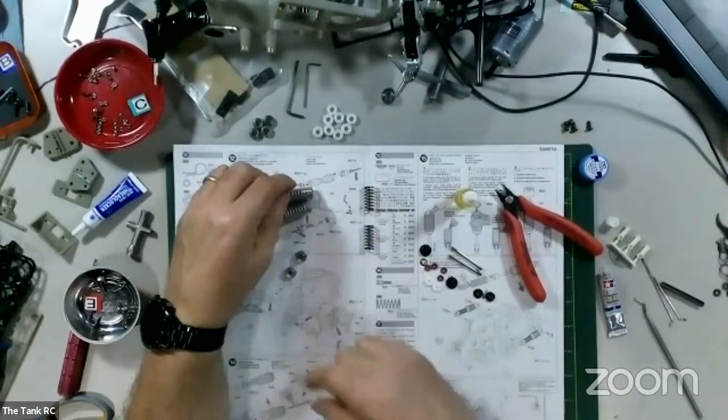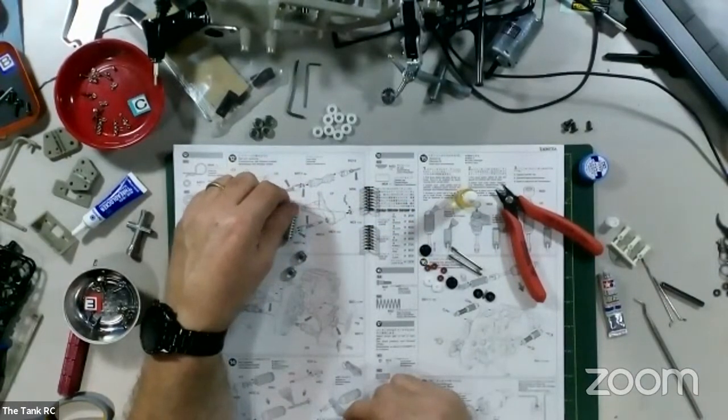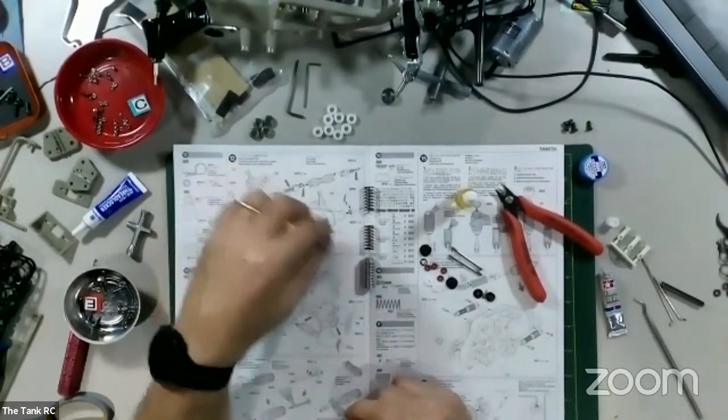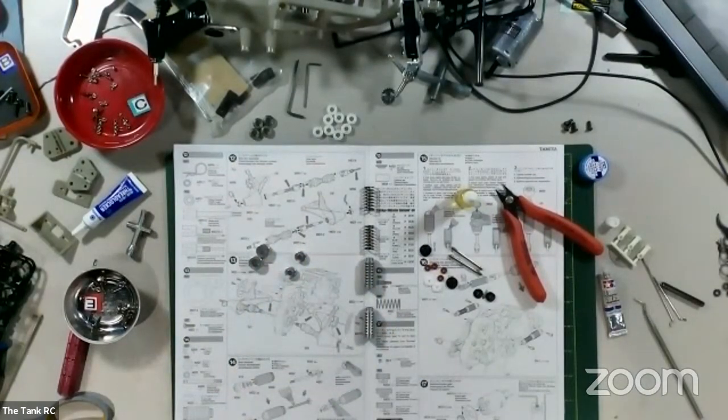I got this gonna break. I got a motor for my holiday buggy. I took the whole thing apart to try to switch it to 20 degrees because I'm allowed 20 degrees, but it won't turn 20 degrees. I only got it to go 10. I don't know why it won't move. The ring won't move further. Does it have a 20 degree mark on it? Yes, it does. Go the other way. That's going towards negative. Go the other way and then turn it back again. Sometimes they get a little bit of glue in there from the magnets. You're saying put some play into it. Yeah, go back and forth a little bit as need be. Sometimes you'll get hung up on a little bit of glue coming off the magnet.